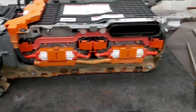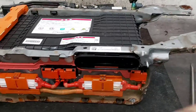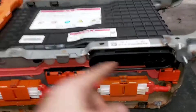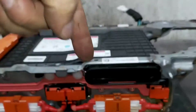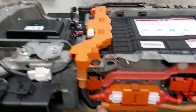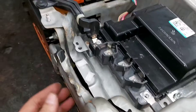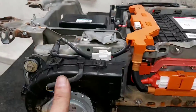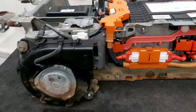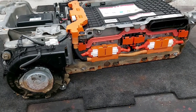Let's review the full cooling system: on the front of the car there's a suction vent connecting directly into the battery inlet and straight to the cells. The air goes down through the plastic assembly, then the outlet from this side enters directly into the ventilation inside the inverter and DC-to-DC converter underneath. Finally, it's sucked and blown out from the battery through the fan. This is how the cooling system works in Honda hybrid vehicles.